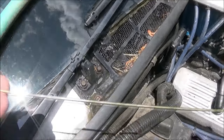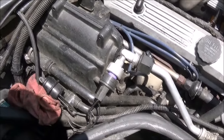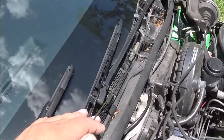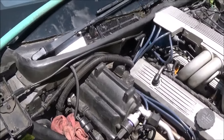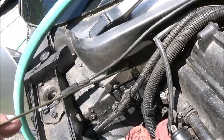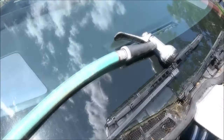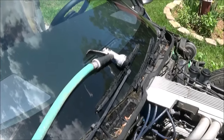They couldn't figure out that it was actually coming from within here. So I cleaned it out using this coat hanger - I just straightened it out and punched it right through the weep hole over here and cleaned it out. Now it's evacuating the water as quickly as it goes in. You can see it coming out right there. Right now I'm just running a test to make sure that in fact that was everything about it.